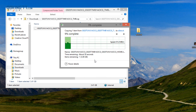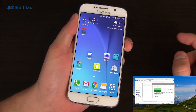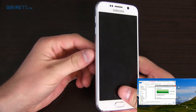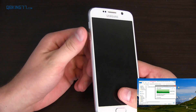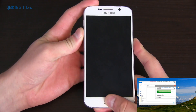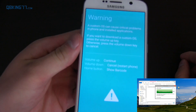That's going to take a bit of time because it's a little over three gigs. In the meantime, while that's transferring over, let's go ahead and grab our Galaxy S6 and power it off because we're going to need to get into download mode. Once it's completely powered off, to get into download mode press and hold volume down, the home button, and the power button all at the same time. Just keep it all held down and you'll see a warning sign pop up.